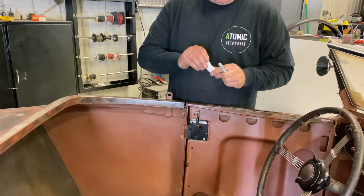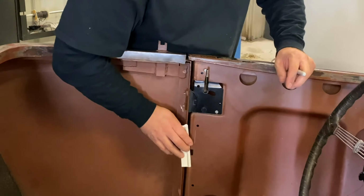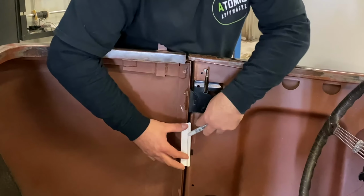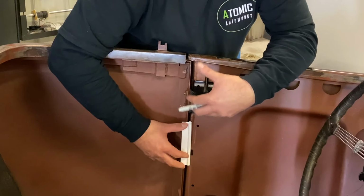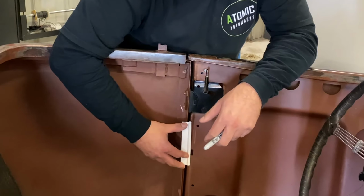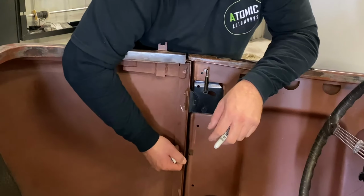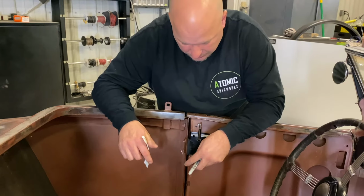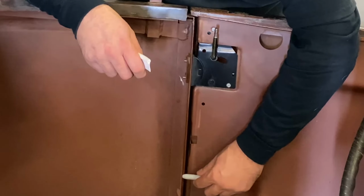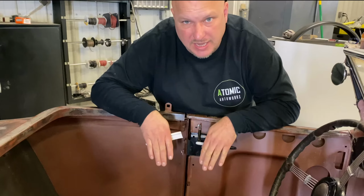Another thing to take into consideration is, actually I'll show you on this side of the car. Some vehicles utilize wind lacing or welt cord. The reason that the older cars would have that is this would sit right here, and this would cover up the gaps where your rubber would normally seal on your newer car to keep out wind noise or moisture or rain or anything that comes through here. A lot of hot rods, instead of using the wind lace style, will use a really thin welt cord too. The reason this is important: if we're making a panel and we want that panel to end right at the edge of here, and this panel to end right at the edge of here with no welting, your template should be exactly where you want it.